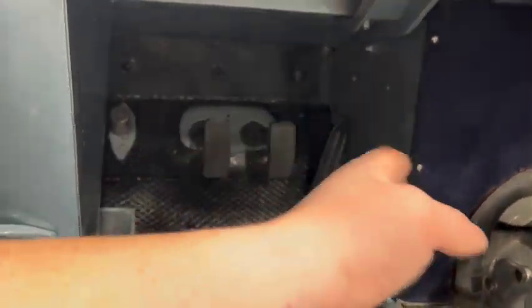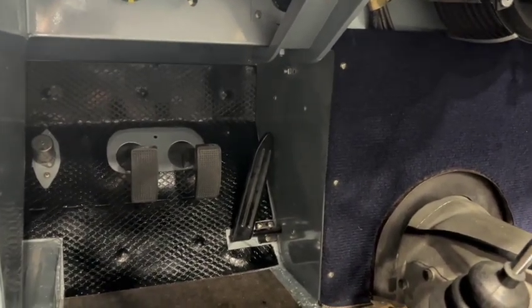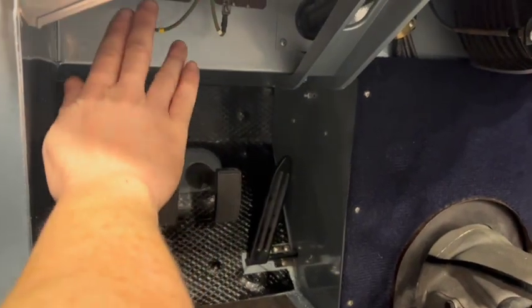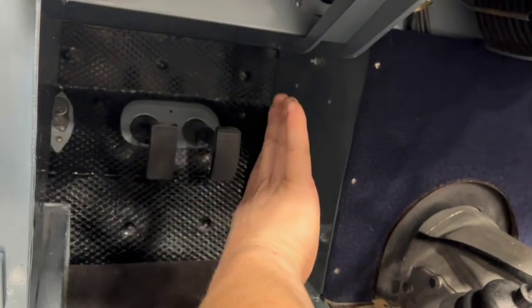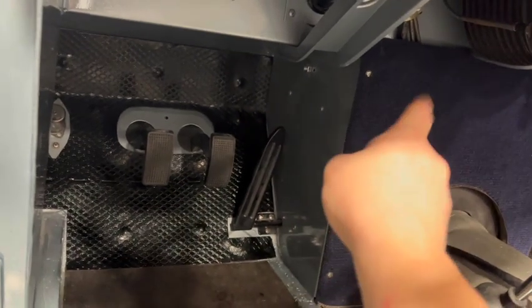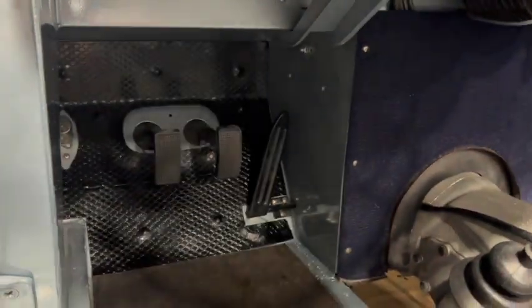Carpet toe boards on BN1s, BN2s, and most Healeys all the way through — the big Healeys — it was one piece of carpet that does the flat toe board angle, so that face and this face here. There's a little cut in the upper corner and it does a 90 on those inside corners, and it also covers this side face and just wraps around this edge underneath of this panel. So I've got to remove this panel before I put in those carpets. It's just one piece of carpet that does these two faces and does the angle there, like I say with a little cut in the corner. I sell these pre-cut and ready to go.